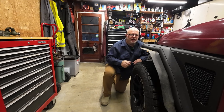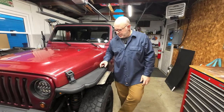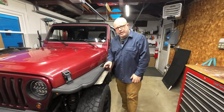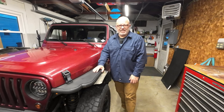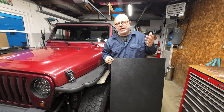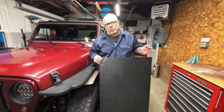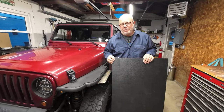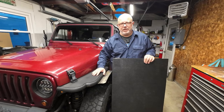So today, I'm going to try to fix this and make it look just a little bit nicer than it does right now. The question becomes how best to do that. I could cut these fenders off, space them out, weld on a piece of steel, blend it in, sand everything down, repaint it — but that's a lot of work. I could redo these out of rubber, or I could try to make these out of rigid plastic, such as this 1/8 inch ABS plastic that I purchased. It's a 24 by 48 sheet — more than enough. It might look a little bit nicer than the rubber and it'll never rust, which is kind of a big deal for this project.